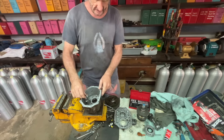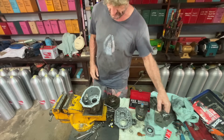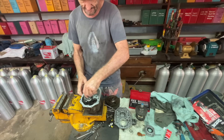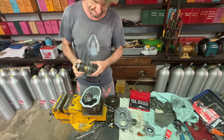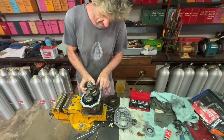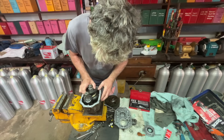Once you've got that clutch cone on, add the spacers and shims, put the other cog back on, put the needle bearings, put it all back on exactly how you took it off, and you've got your clutch shaft rebuilt. In my case with the new clutch cone in. In the meantime I've cleaned everything out, washed and brushed it all out with a toothbrush, checked everything, blown it out with air, and I'm ready to rebuild. Here's where it pays off that you took care when you took it all apart - it's all in very precise order.